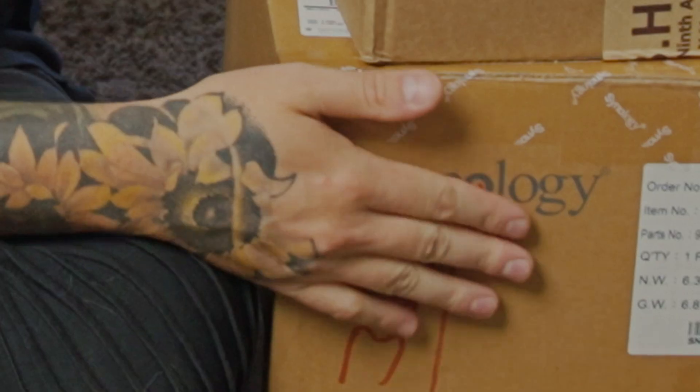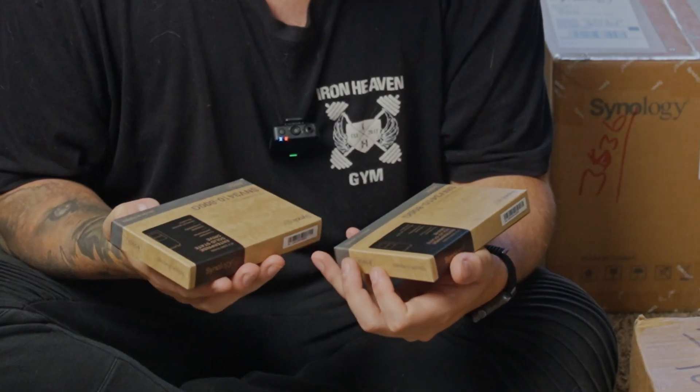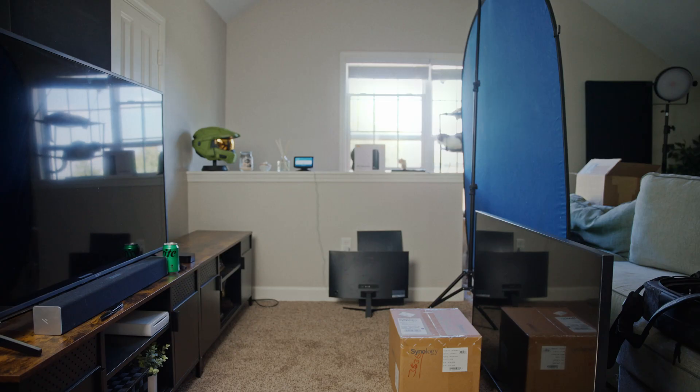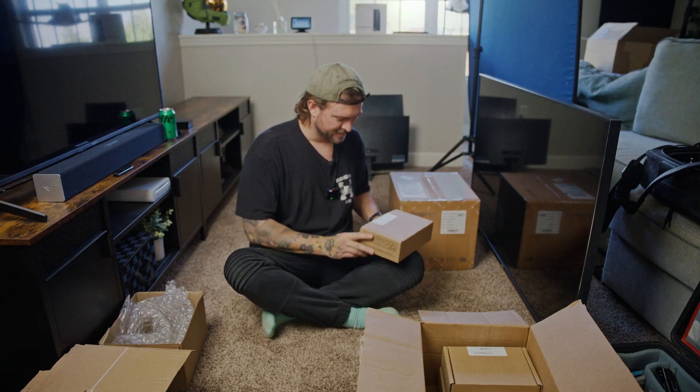This is a big moment. I may have had years of my work completely obliterated via my own mistakes, but those are now being fixed forever with a NAS. We have two Synology brand M.2 2280 NVMe solid state drives, enterprise class, each 800 gigabytes — I've heard using these as a cache is good. In this box, we have 16 terabyte IronWolf Pros. I got four of these to put in the NAS — it's a six bay NAS but I couldn't afford six.